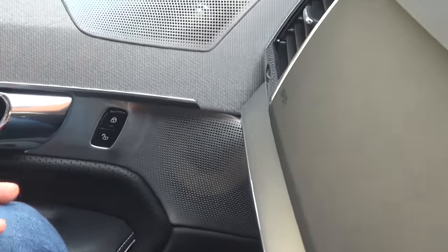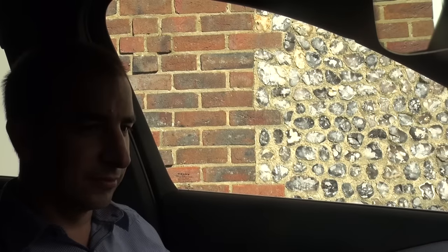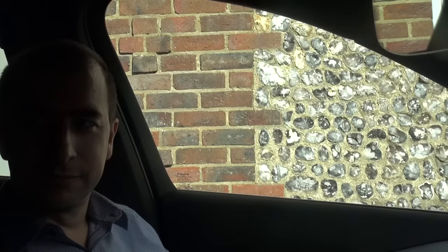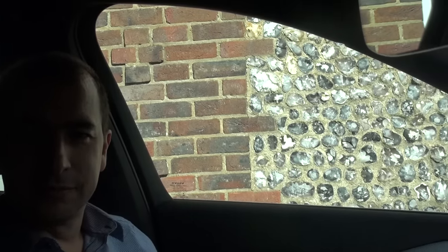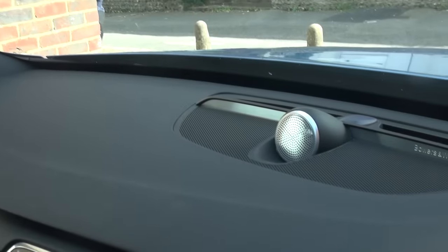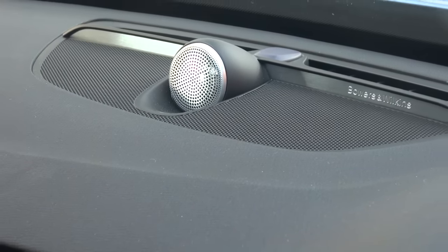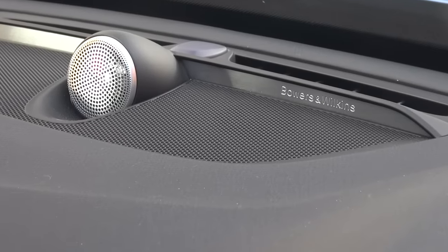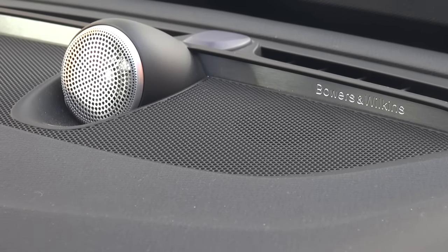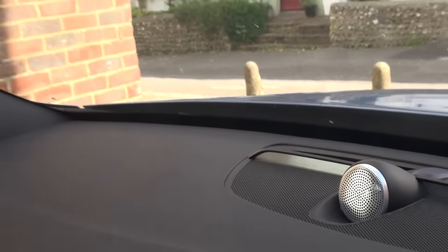So it's integrated in a kind of spiral package — a much lower profile for automotive applications in particular. As I zoom in on that yellow speaker cone, what Stuart is telling you about is in the front of that lovely brochure about this car — there's a picture of the Nautilus speaker. A big part of why the tweeter sounds so amazing is the Nautilus technology: that long tube behind the tweeter, curled up behind it in the car door. The dashboard has got the same Nautilus tweeter, mounted above the dashboard and facing down the car rather than up at the screen — which is very advantageous because you get an increased ratio of direct to reflected sound, less of a comb filtering effect, and more of the direct sound from the tweeter.